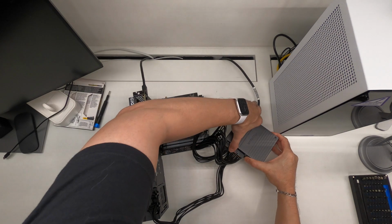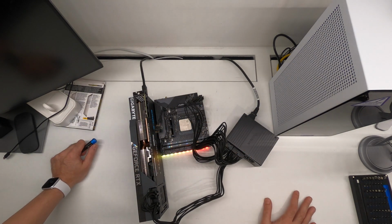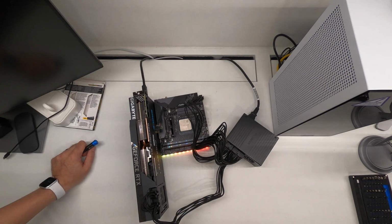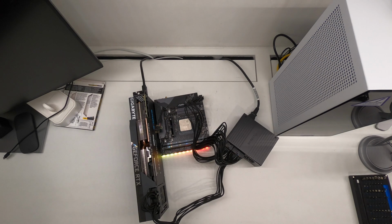And we can see the motherboard has power. Okay, so now we've got power connected to the motherboard. The motherboard's flashing. I am very well aware that there's no heatsink connected right now. The goal here is just to have the machine turn on for a few seconds just to see that you get a POST, i.e. you get your intro screen and your BIOS, then you can shut down. That is enough validation, I feel, to start mounting everything into the case.